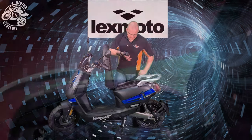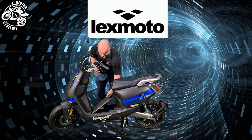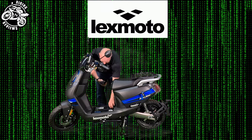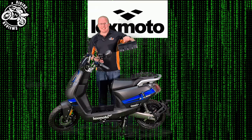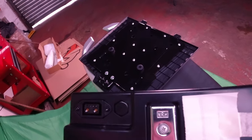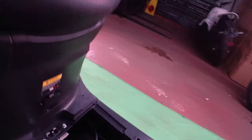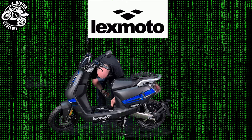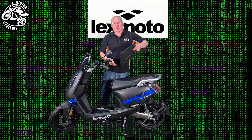If we open up the seat, there's a rather large storage area in there. Pull that little handle down and you can access the battery compartment — it's got a plastic top with a metal underneath. It comes with this large 60 volt 24 amp hour battery. It's fairly easily taken out so you can take it upstairs to charge. It weighs about 15 to 20 kilos. There is a charging port on the battery itself, and the charger comes with the bike. You can either charge via the battery directly or plug in without removing the battery. The battery also has a charge status indicator so you can check the level even when it's off the bike.